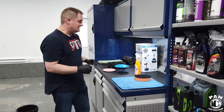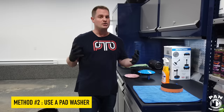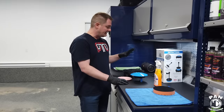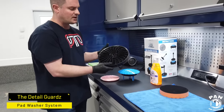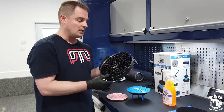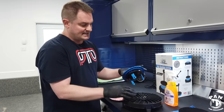The second method uses something very ingenious — a pad washer. There are many different versions out there. If you have a high-volume shop setup or use a lot of pads and want to increase efficiency, for a typical vehicle you'll use anywhere from five to six pads for compounding and five to six for polishing, so roughly 10 to 12 pads total. One I like is from Detail Guards — their pad washer system. At the bottom of your wash bucket, whether it's a three-and-a-half or five-gallon bucket, you typically have a grit guard. This is the Detail Guards Dirt Lock, which I love — I've done a review on it on my channel. Their system is a pump that locks in to your Dirt Lock.